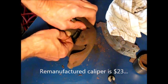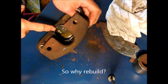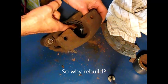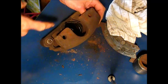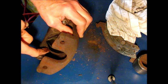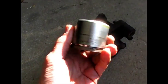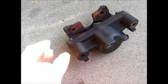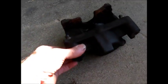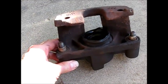There are two seals that are part of this. One is a dust boot, and the other one, further inside, is the seal that does the work that contributes to the piston's in-and-out action. With some of the marring on this piston and the fact that one of the caliper pins is seized up in there, I've decided to go with a rebuild on this side. They're only $23 at Napa, complete with pins.